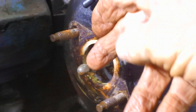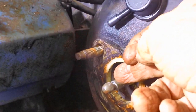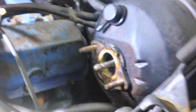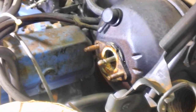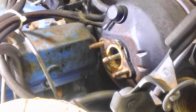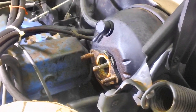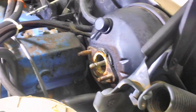What we have here is a little piston connected to a diaphragm inside this booster. When you hit your brakes and you have a booster, the vacuum operates the diaphragm which enables the piston to push forward. I have to check to see if that diaphragm has any holes — it looks okay but looks can be deceiving. It's got some dirt and crud in it so chances are it may not be good. I've got a pump that can pull a vacuum on it — about 5 to 8 PSI — to see if it holds. Not only do I want to check the vacuum, I want to show you how to adjust that rod that's connected to the diaphragm.